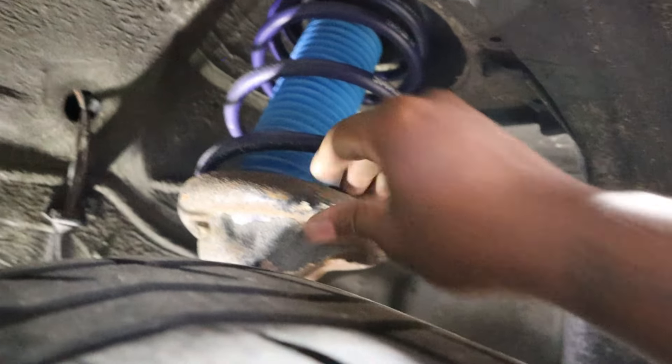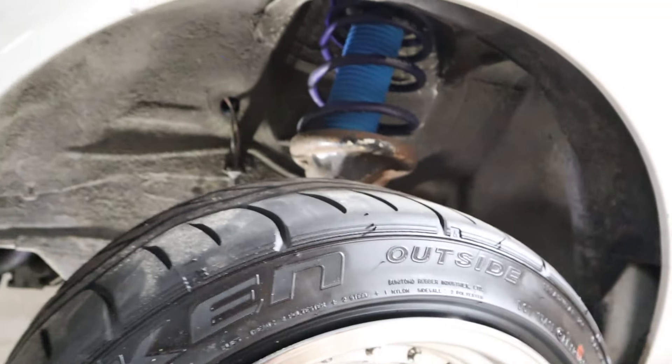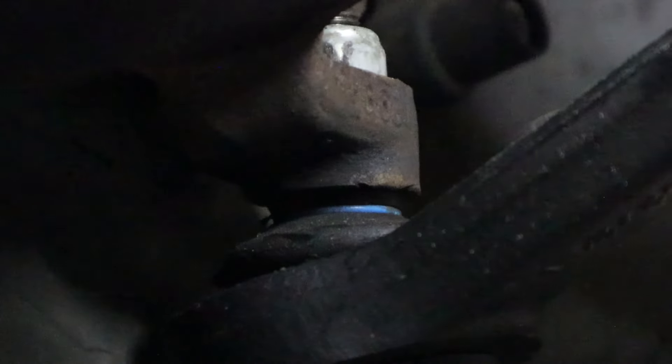Check your springs too — make sure you've got no rattles, nothing's moving. Give it a little push. I'm pretty sure those ball joints are toast. You can see right at the top that bushing is a little eaten up with a tear in it. These are just some quick tricks to diagnose suspension noise. For me, I'm pretty sure it's going to be my inner and outer tie rods, and possibly my ball joints — they've also seen better days. Thanks for watching and I hope you learned something!